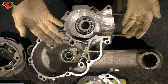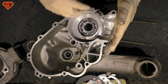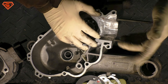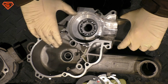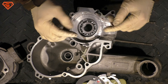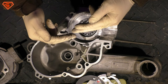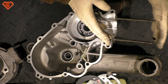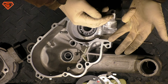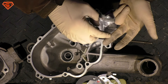Why would you buy a T5 engine? Let's go to the parts which are different: cylinder, crankshaft, carburetor, cylinder head, exhaust — in the end all the main tuning parts are different than PX. How many T5 Vespas have been sold? Way less than PX. This means the selection of tuning parts is way smaller. For PX you have around 40 cylinder kits; for the T5 it's like two or three cylinder kits you can choose from.